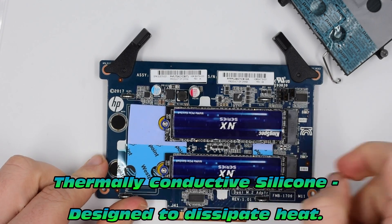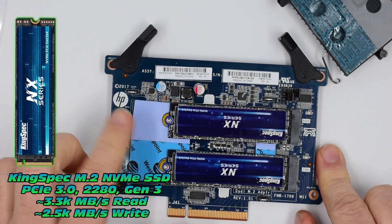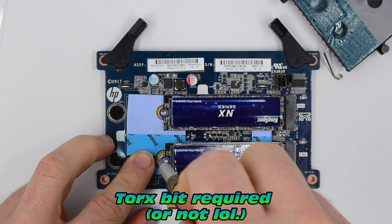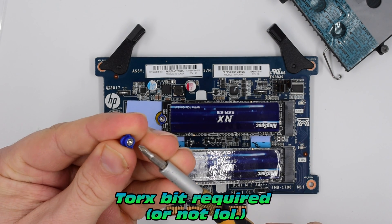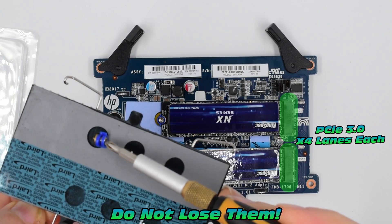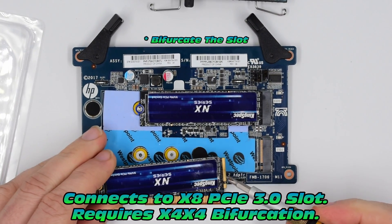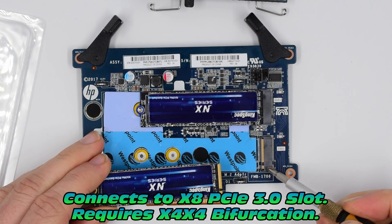We'll also remove the cheap NVMes I picked up off AliExpress. Check out the mounting hardware — these screws are really cool, they come with a little recess that fits into the groove of the NVMe. There's the M.2 slot on the far right, which provides x4 connectivity for each NVMe, allowing maximum speed for that drive once we bifurcate the PCIe lane — but more on that later.